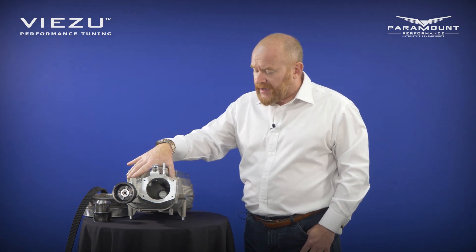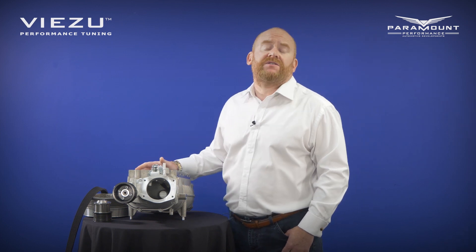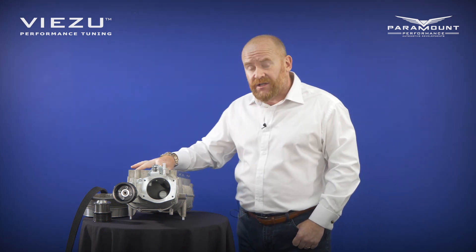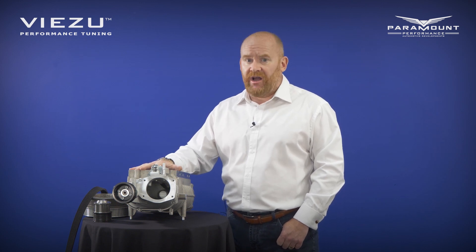Do get it investigated if you get this noise. The other issue is that if these bearings become worn and start to make a noise, they can actually be replaced — your supercharger can be reconditioned. It's a service we offer. This charger is about £2,400 out of the box; you can get it reconditioned for just over £1,000, which includes the snout bearing and both front main bearings. However, if you leave it too long, the blades inside the supercharger can get too close as the bearings wear, start to cause friction and rub. Once those blades are worn, the supercharger goes in the bin — they can't be changed, and replacing them would cost more than a new unit. So two reasons to act quickly on a noisy front bearing: it can cause complete engine failure, but catch it early and reconditioning is much cheaper.